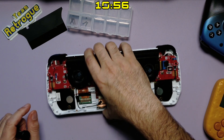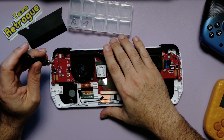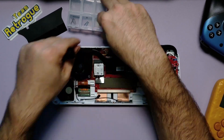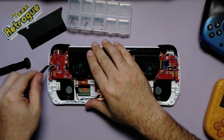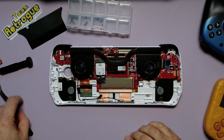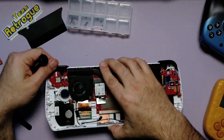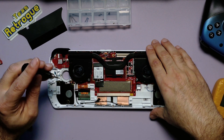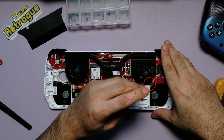If you're ambitious and want to swap out some other parts, keep watching. It's time to disconnect the joysticks. We'll start with the right joystick by removing the screws circled on the screen, then carefully disconnect the ribbon cable and remove the joystick assembly. These three screws are part of the many that hold the motherboard in place, so let's remove these, as we will have to move the motherboard to access the face buttons. Working left to right, let's also remove two more motherboard screws, then head to the right side and remove those two screws there.